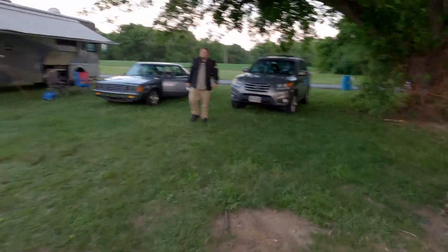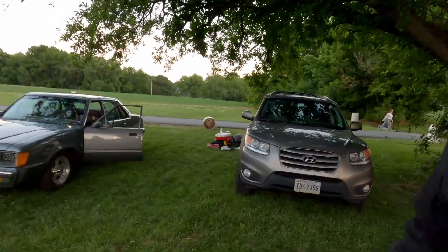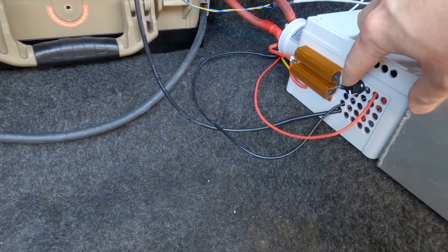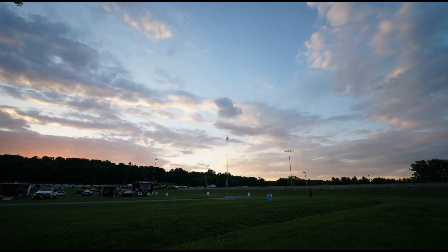It left a lot harder because the glove box door opened up and everything flew out, but it laid over — I don't know, not too far into the run — like it just lost everything. So I went ahead and turned the power off and just kind of coasted it, looked at everything, checked the gauges. We checked everything out and it looked to be a glitch from the Arduino that controls the ESC. The code gets flaky at a hundred percent, so we backed off the power a little bit. We have one last chance to get a clean pass.